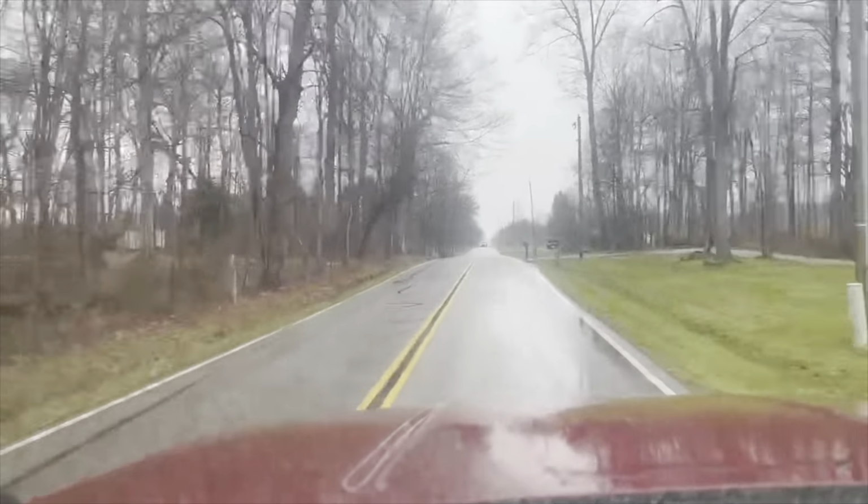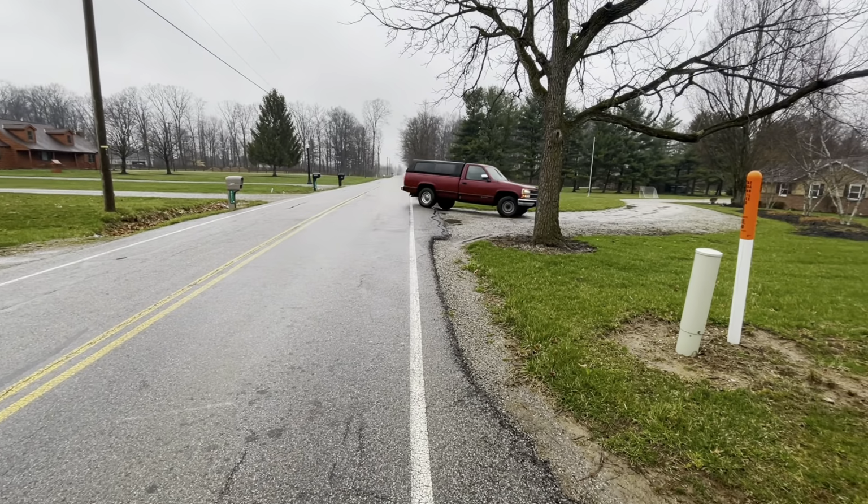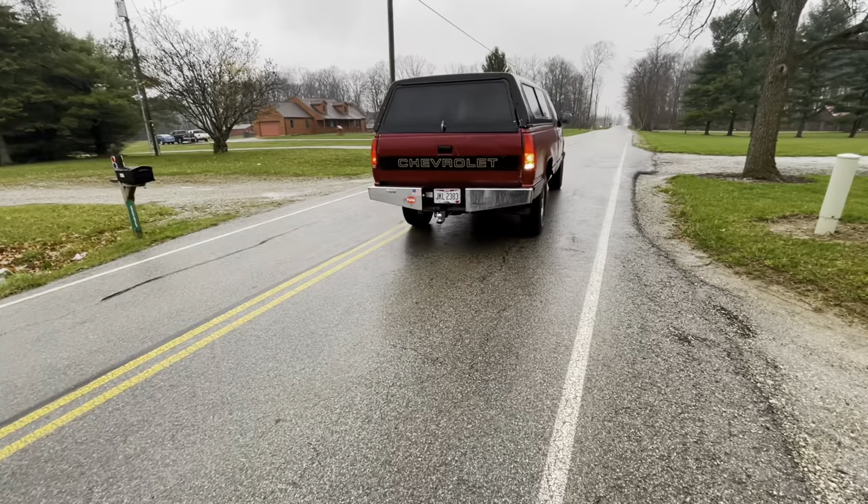I'm about 4 miles from the farm, and I think the crankshaft broke. We're done, unless Jeremy can come tow me with a chain before the air runs out. So if you're not familiar with dump trucks with air brakes, the brakes work on pressurized air. And there's an air compressor on the engine that pressurizes the air tanks.